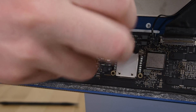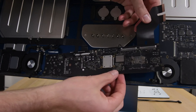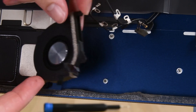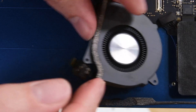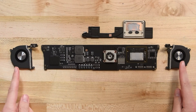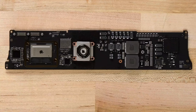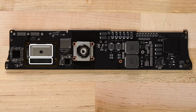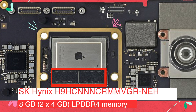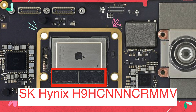The board is similar to the one we saw in the M1 MacBook Air and is held down with 2.5mm nuts — a strange choice, but again anything is better than glue. Before we take a closer look at the silicon, we'll pull the fans out so we can look at the whole cooling system together. Four screws hold the heat pipe on, and underneath is the star of the show: the M1 chip. Thanks to the M1 architecture, this is the smallest iMac logic board yet.